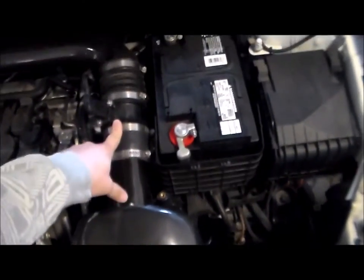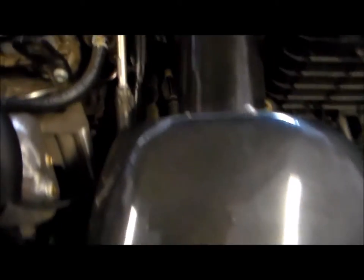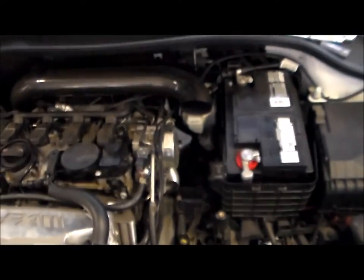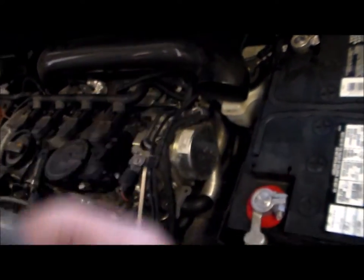What I'll have to do is take off my intake box and my MAF, and then the shifter is literally right underneath there. There are some installation videos where people actually take out the battery to give more room, but I think this will be enough room. I went ahead and removed the air box and the MAF housing — all I needed was a T25 Torx bit to get the screws out, and then an 8mm socket to get the clamp off for the housing side, and then pulled it all out in one piece.